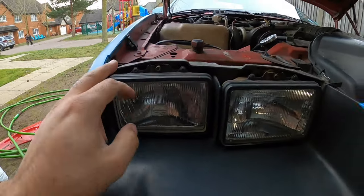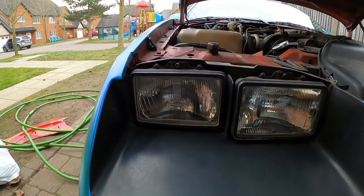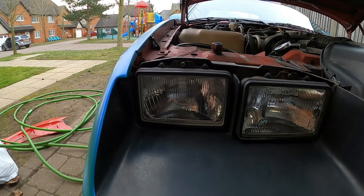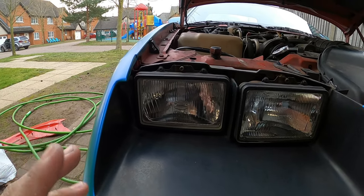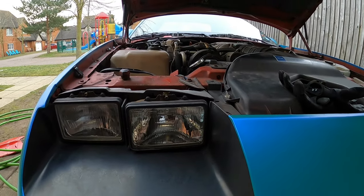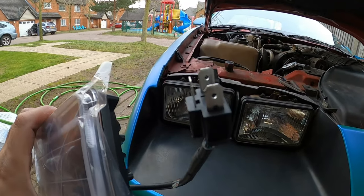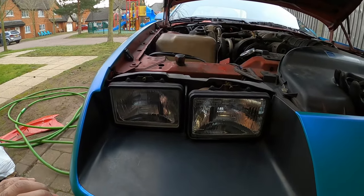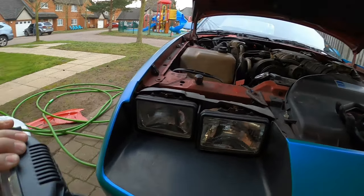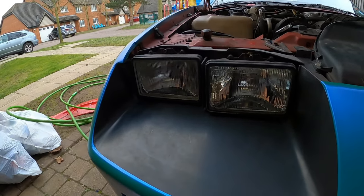All right, so if you look at it, there are two screws here — one, two — and one, two at the bottom. This bracket comes off, the headlight comes out, you unplug it, and then you put in the new headlight and put those four screws back in. That's as simple as it is — one, two, and then three, four on that side. When it comes to wiring it, there's a plug-and-play system that's got the same plug as the Camaro has — the three-prong — and then this other plug is for the halo piece.